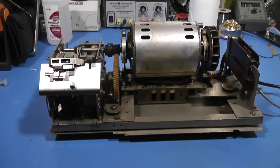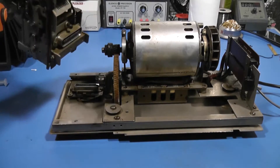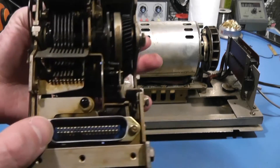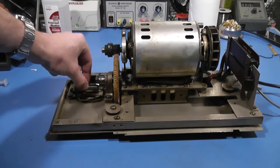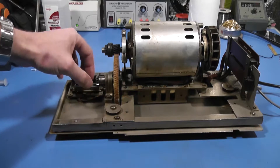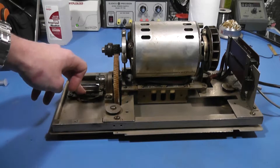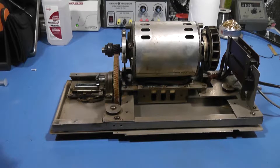Now I'm going to take the LXD off of the base and take a look at the underside of it and how it connects — it's kind of clever. There are three screws that hold the LXD to the base, and it just lifts off like that. If you look on the bottom, it has all of the electrical contacts for the LXD, and it looks a little bit like a Centronics connector. It just dogs into this connector down here, which floats in the base so that alignment can be governed by the actual mechanical drive. It also has a switch here that would cause it to power off when the LXD is removed from the base, although that is not functional in this particular unit.